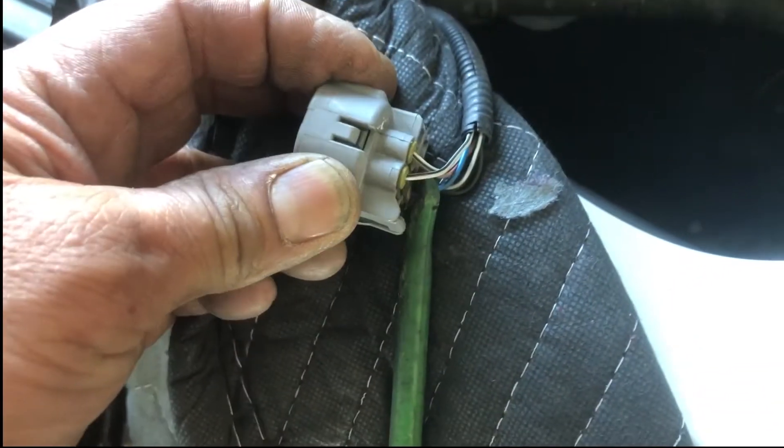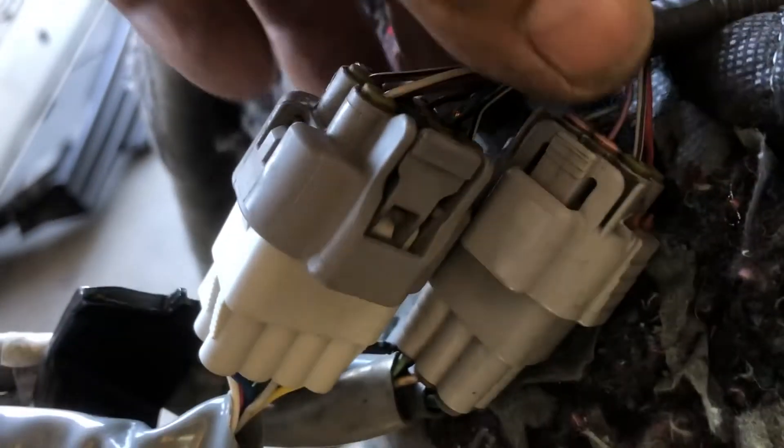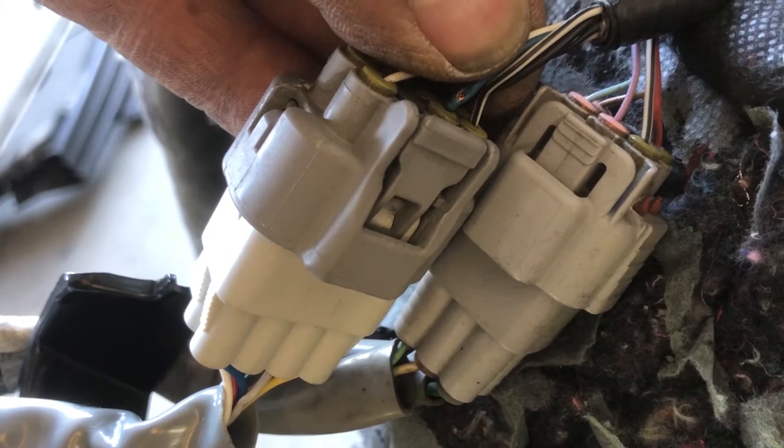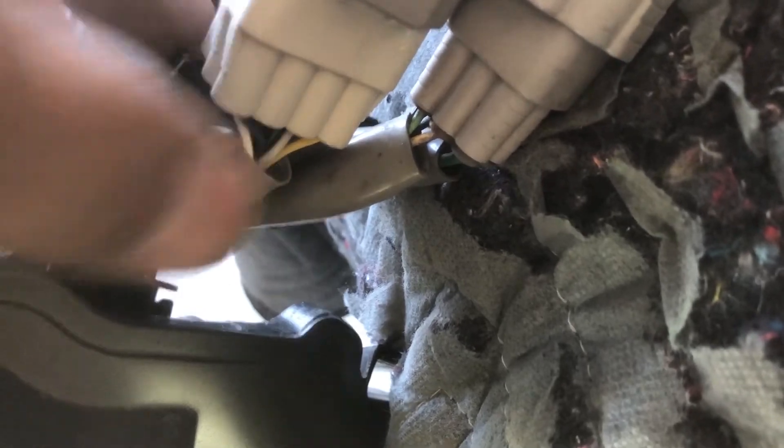The problem is in here. I don't know if you can see that, but the blue wire on top of this molex plug right here — it's pinched right there. I get 12 volts when I put the high beams on, and it converts into a gray wire and yellow wire. I'm going to test the gray wire — 12 volts on my probe — and it's on the gray wire, which is the output of the module.